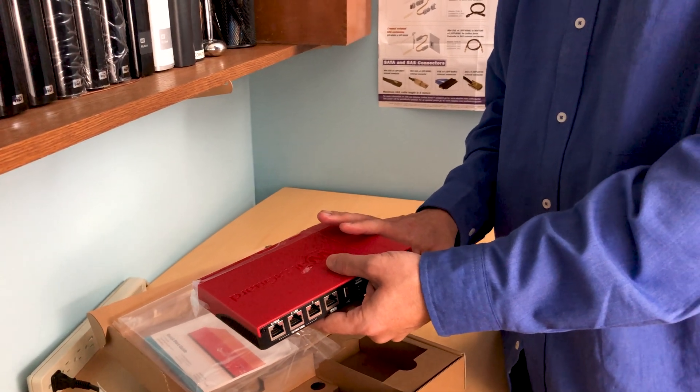It's really easy to set up: the WAN port goes off to your provider and your internal LAN. This unit can provide DHCP service, giving you IP addresses for internal use. If you have an internal server, I would recommend putting DHCP and DNS on your domain controller or your local machines.